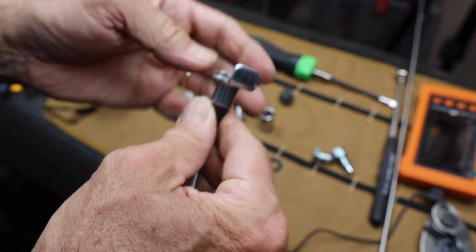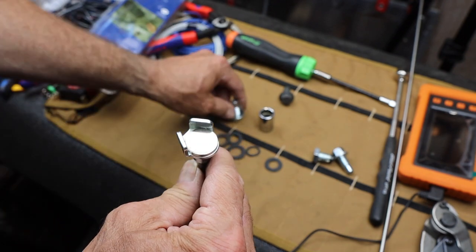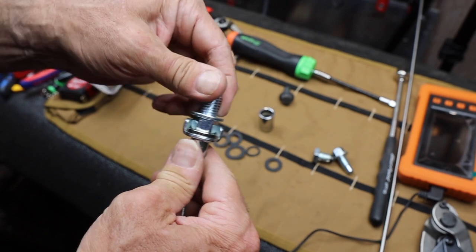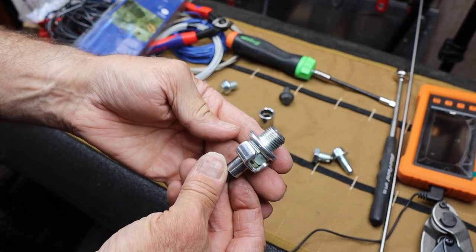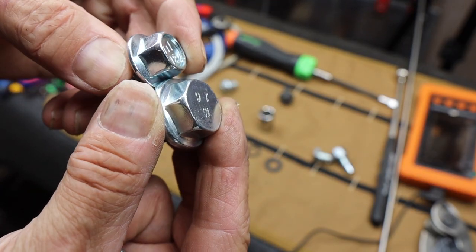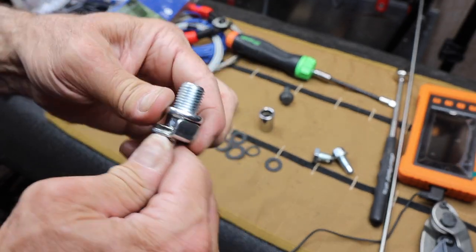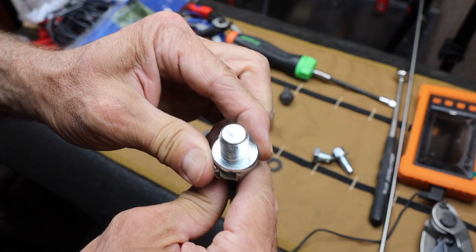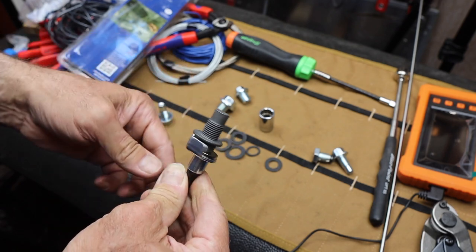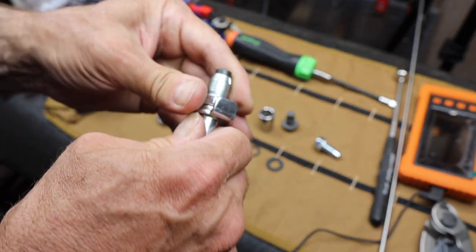All it is is a neodymium disc magnet — about the size of a nickel — in this holding mechanism that's got two angles for hex bolts. I've got several drain plugs here. Here's a 12 millimeter — locks up quite well, fits right in, no problem. Here's a 16 millimeter — you can see how that fits in there, no problem, a lot of grab. If you have a relief bolt compared to a flush bolt, this one is still plenty tight, but not near as tight as a flat bolt. Here's a flat — probably a 12, or maybe smaller — in there, nice and snug, it's not going anywhere. Here's a half inch drain plug — no problem obviously. Here's a magnetic one with a little ceramic magnet on the drain plug — no issues there either.